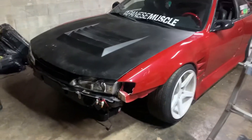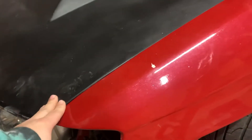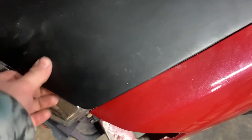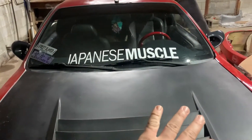I am almost there. A little bit more fitment to get this to go down. It looks like I had to loosen it up and move the hood this way — it's hitting here, and I have a gap here. So I'll have to loosen it and pull the hood this way.